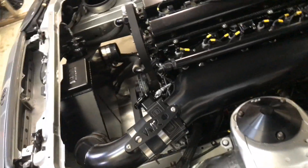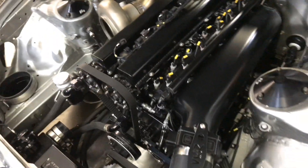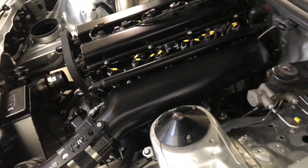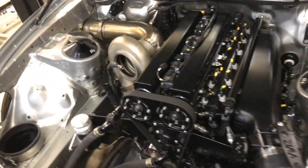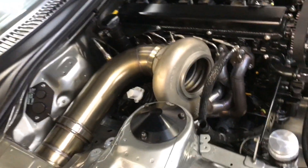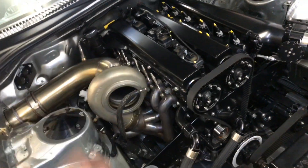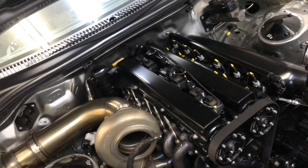One connection — not having to undo everything, lean it to the side, and do an engine change. Sometimes you're trying to do it fast at a track or overnight. The wiring is also super robust — it can take a lot of temperature. We route this side of the loom right under the header and use Raychem DR-25 on that, and even the heat of the header doesn't melt it. It just takes a beating. When installed and routed correctly, it ends up being a nice package. Next, I'm going to raise the car up and show you some stuff underneath.